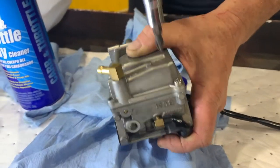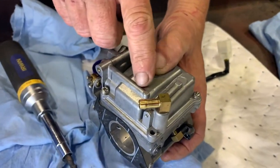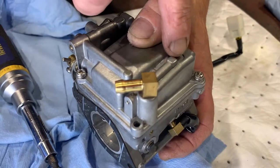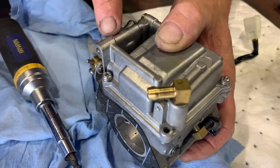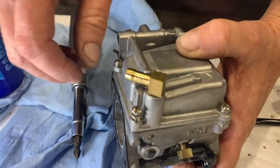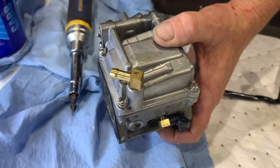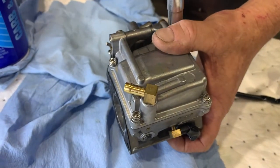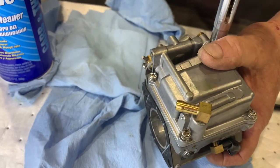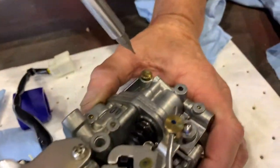Great new learning experience from my mechanic friend, John. My pleasure. Remember you asked how the fuel moves around in there? See, these are fuel ports in the casting. So fuel is actually moving through these castings. Got it. So then we're basically putting the four screws back on, tightening them down, and then it's time to reinstall our carburetor, isn't it? That's right. We're also gonna look at our overflows. Just make sure that there's nothing accumulated anywhere where we can't see it.